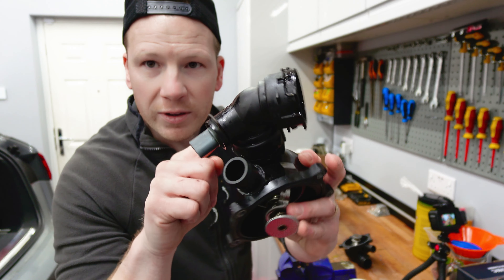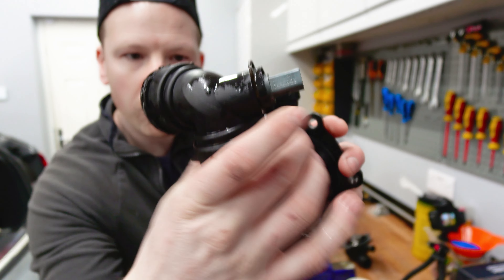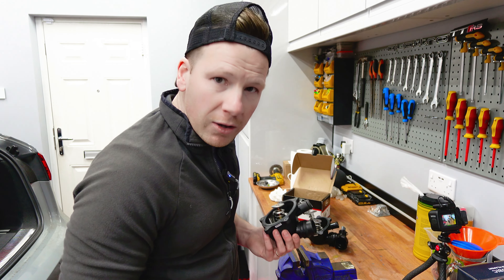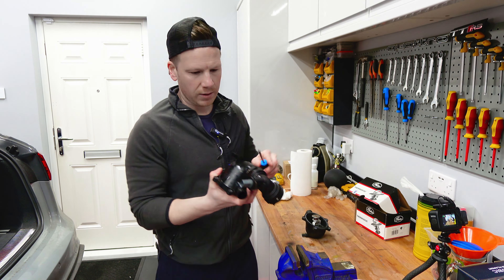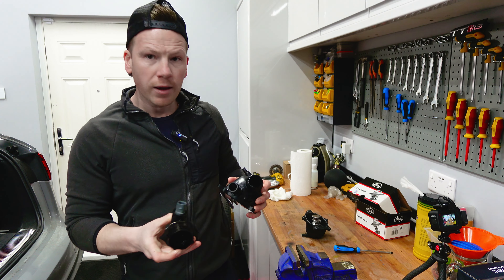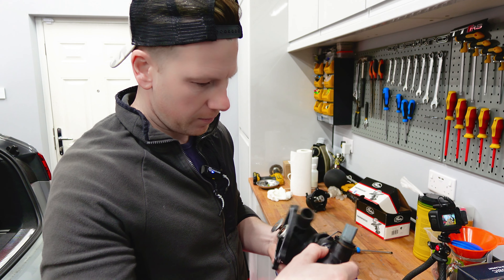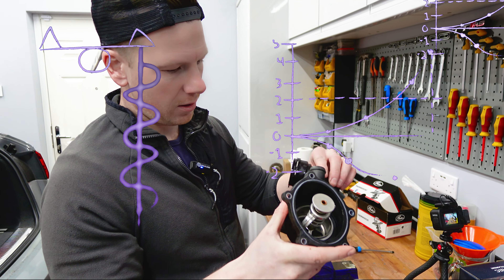It's not branded by Audi, but I'm pretty sure it's the same manufacturer. On the new one you can see the actual Audi part number is not on it, whereas on the old one it is - so I'm pretty sure it's the same manufacturer. Don't throw this out with this bit on - I'm going to need this bit. This bit comes off with a little clip. We'll pull that out, pop this off, and that will go on the new one. Let's change these parts over, get this one fixed, and then I'll show you it once it's in place.